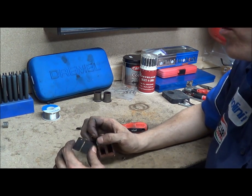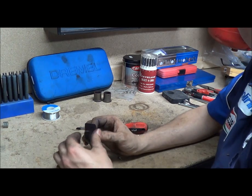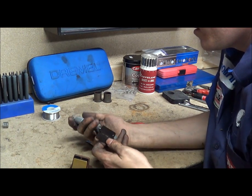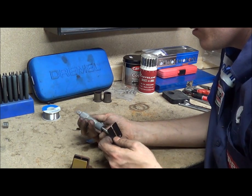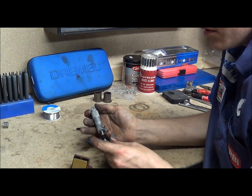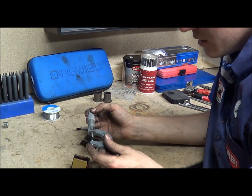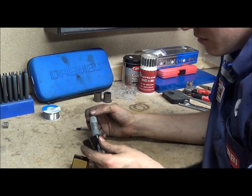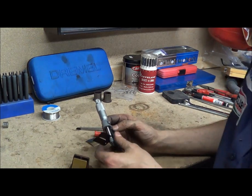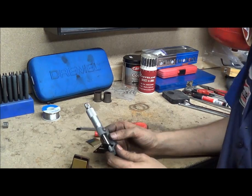You can try different materials — buy different types of sheets of plastic. These things are tiny. These are standard reeds off a Piaggio Zip, and measuring the thickness with a micrometer, they're running these reeds at 0.36 millimetres.